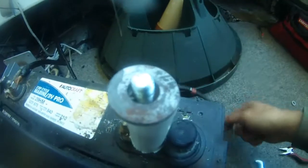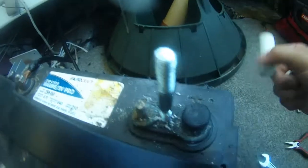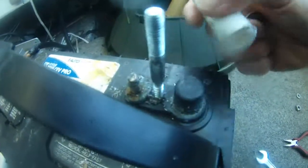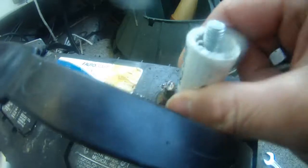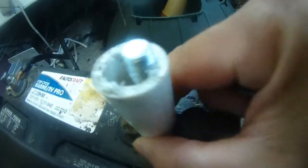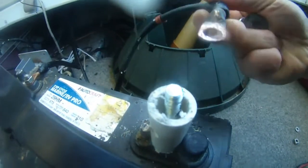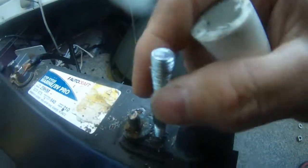It's not perfect because it's not level. So what I'm going to do is try to build something that will be level — put something underneath to make this PVC pipe level, then put the washer down, then the terminal ring connector, and then I'll be able to lock this terminal tight onto this stud.